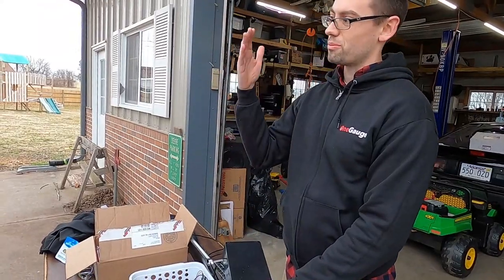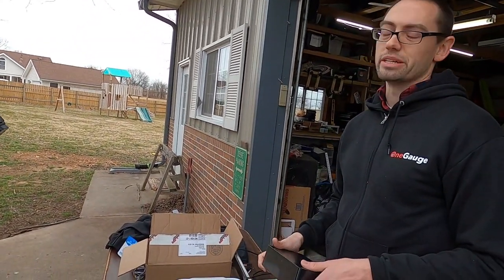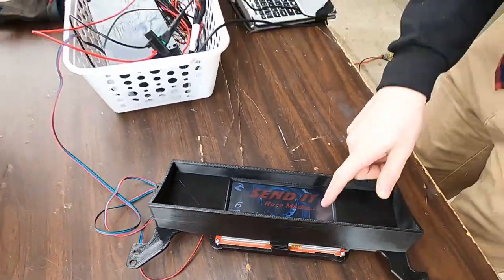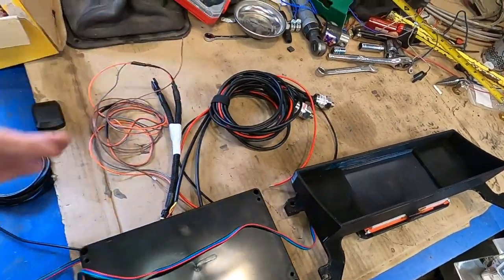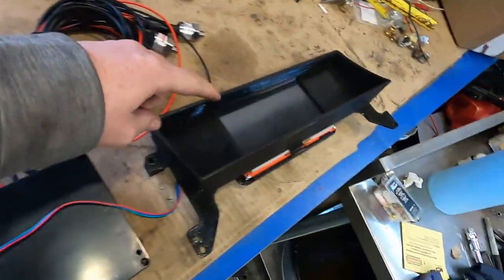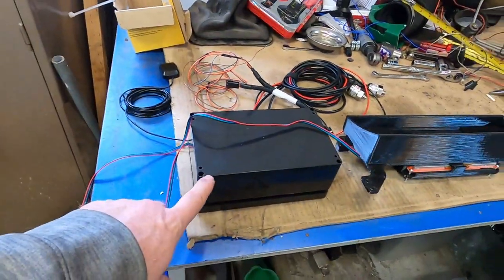You're also not locked in. If you bought a dash specific to one manufacturer, you're stuck with that manufacturer's ECU. But for this, the goal is to make it pretty universal. Say you buy a car with a Holley system, sell it, and buy a new car with a FiTech — all you have to do is switch over the hardware, keep the same dash. And absolutely — you can do custom backgrounds too. Here's the full One Gauge setup: low dollar motorsport sensors, the wiring that drops into the Holley setup, the dash, the sensors Holley reads off of, the GPS unit, and the control box.